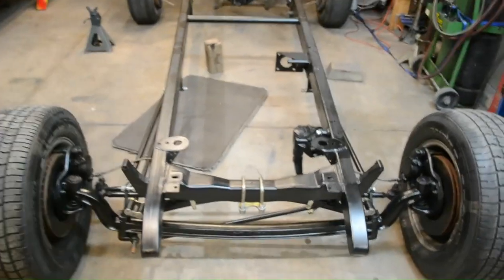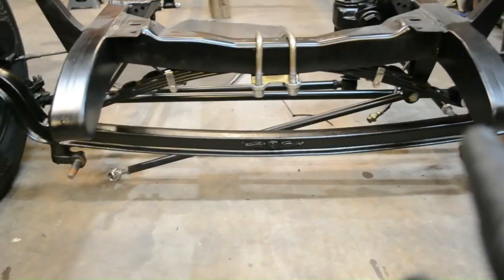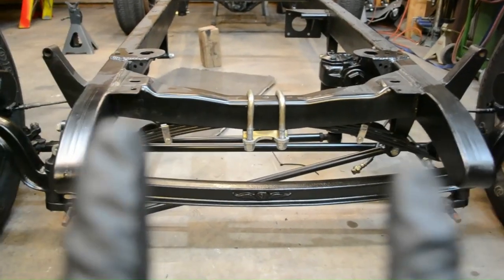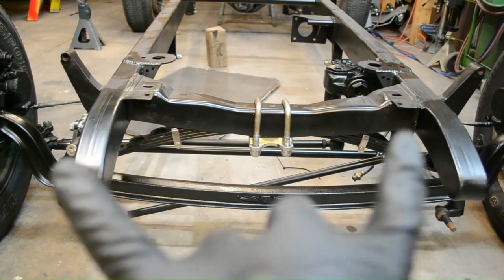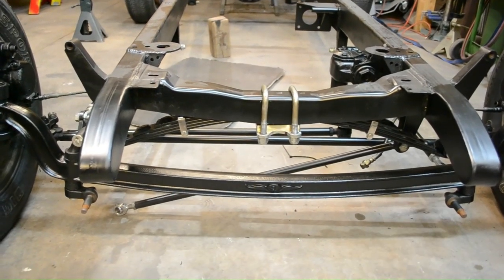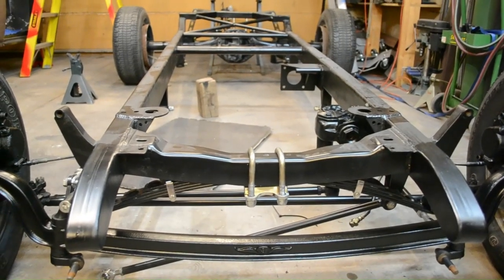And I would just say the trick is, when you do hook one up, just like any good off-roader would tell you, make sure that it is parallel so that it doesn't screw up your geometry. If it's too long, it's going to make the frame cycle left-right as you hit bumps and the suspension cycles up and down. So just make sure it's as level as everything else at ride height. Yeah, that's it.